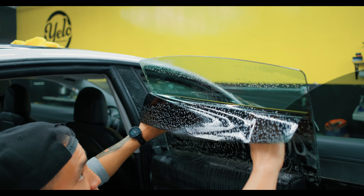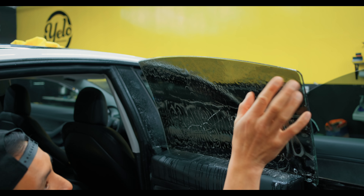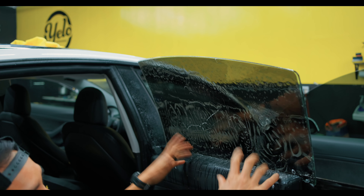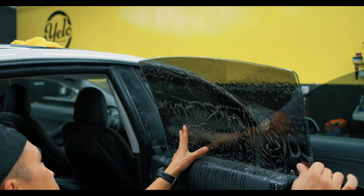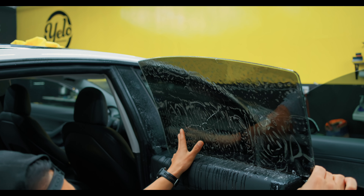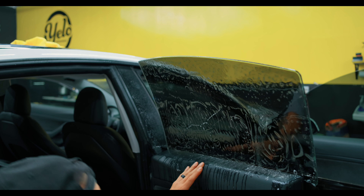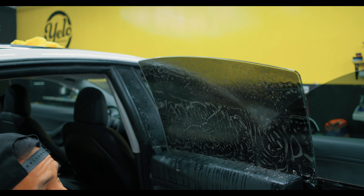When you're down this far you should be able to roll this up and fall just below your top edge — just like this. Your film never actually touched the top, which means you didn't have any chance of getting contaminants on it. On frameless windows you often get contaminants near the top line, so you want to avoid touching that. Now all I have to do is line it up and make sure I've got even distribution — the light gap should be the same at pretty much all angles, nice and uniform.